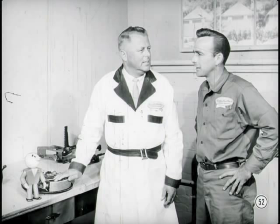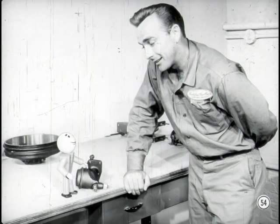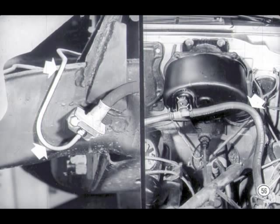A few brake applications will dry them out, though. Sealing around the wheel cylinder at the opening in the dust shield will help keep water from getting in in the first place. Now, here's another condition: occasionally we hear reports of loss of pedal when the brakes are hot. This condition is usually the result of normal wear on the linings, and a shoe adjustment should correct it. If you ever make a mistake and install a Valiant one-inch master cylinder on other models, you'll cause excessive pedal travel. The bore in the Valiant master cylinder is smaller than the others, but you can identify it by the boss on the right side.